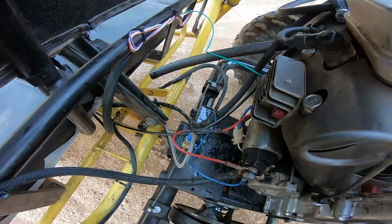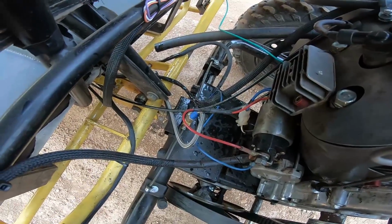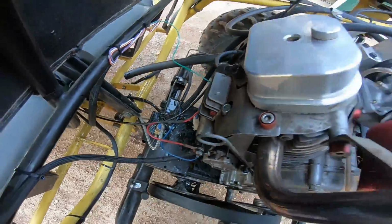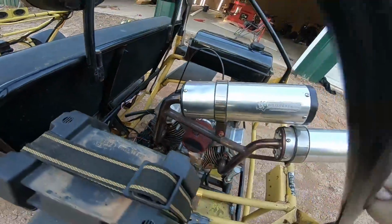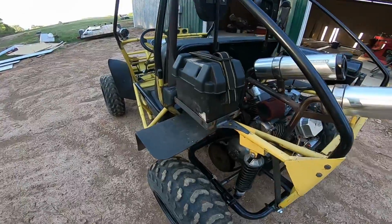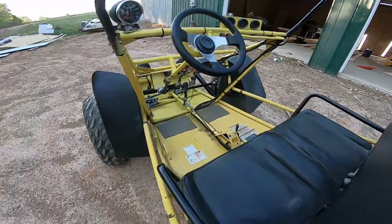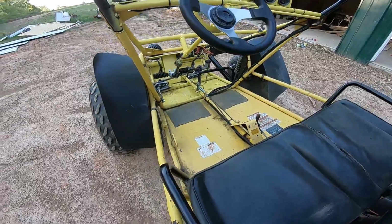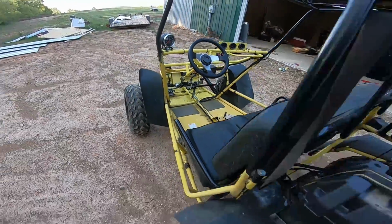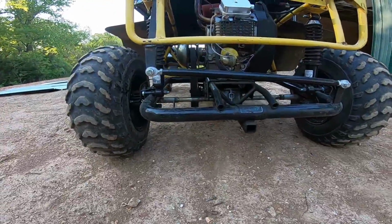And it's not blow-by necessarily, it's sloshing around. This engine's being bounced, and I don't like these wires just got soaked in it. But we'll throw a catch can on here before he gets it for sure. But everything's performing awesome. I moved the battery box up here. It was in the passenger side floorboard, and I do have to put a footrest in. But all this will happen before he comes, and he is wanting a diff cover skid plate under there, so we'll be doing that as well.